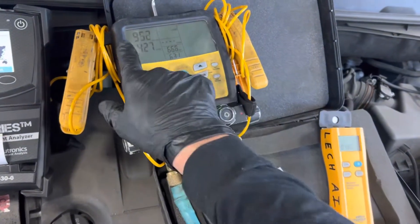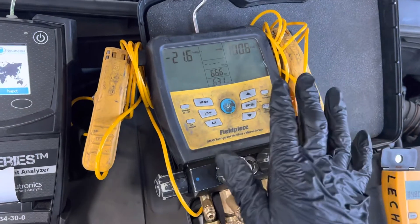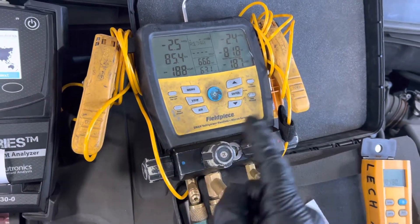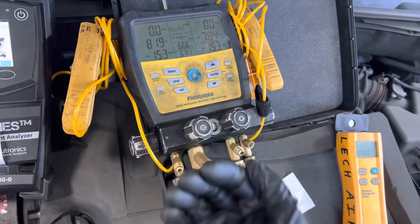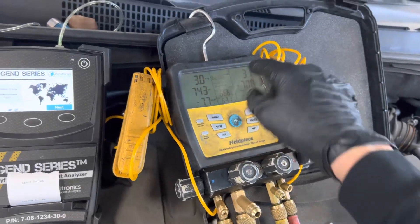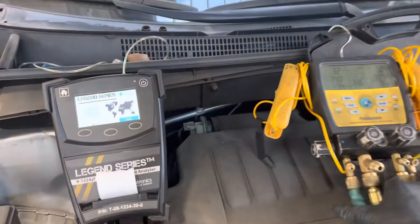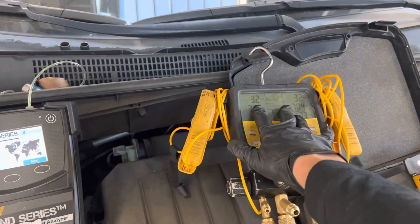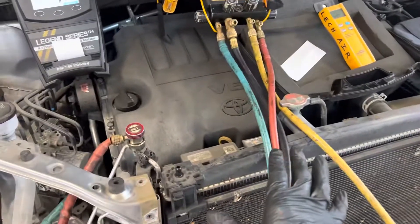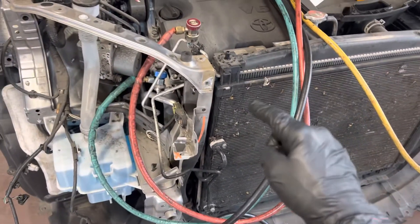The high side is open. Now let's open up — this is the nitrogen right here, hooked up to the regulator. A little squirt — we almost went to zero, that's how fast it went. I want just a little bit of positive pressure, like one PSI — air blowing out when he disconnects the line. Did you see that jump to 40 for just a split second? Since this is such a large system — a dual HVAC system with an evaporator in the rear — you can see the lines right there: that T is the suction line going to the front evaporator, and that T is the suction line going to the rear evaporator. I now have 3 PSI of positive pressure of dry nitrogen in the system, so there'll be an exit of nitrogen rather than an entrance of wet, moisture-containing atmospheric air. That's it — it's that simple.